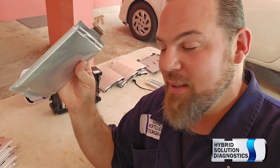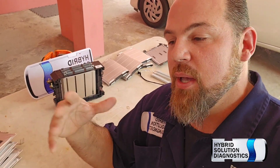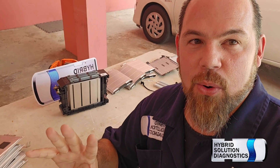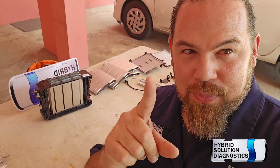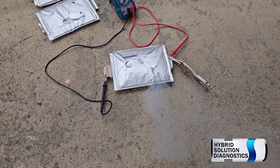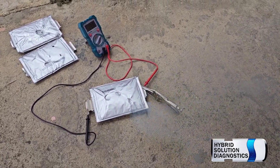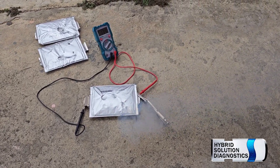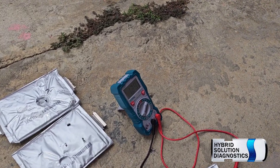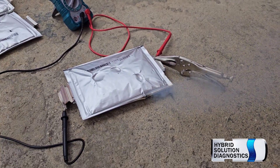We're finished with the test today. I hope you guys liked it. Hybrid Solution Diagnostic is here to show you the very truth. So finally, the 12-volt battery of the Kia Niro and Hyundai IONIQ — when it begins to swell, just replace it and that's it, because it's just going to lose its capacity. But it's very nice that you will know that so far, no fire at all. Yes, they go to thermal runaway and develop lots of temperature, but we're almost done. With this cell, we did something a little more interesting — we smashed it with the hammer without opening it and she went into thermal runaway. I just want to make sure if she produces fire or not. She's in heavy thermal runaway — but so far, no fire.